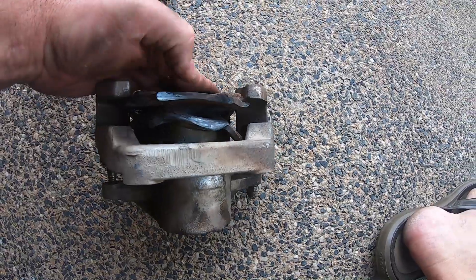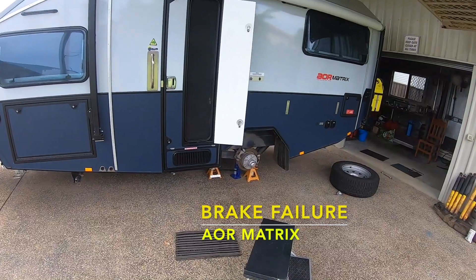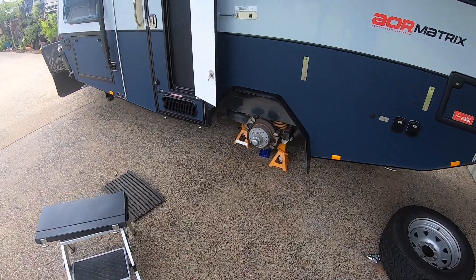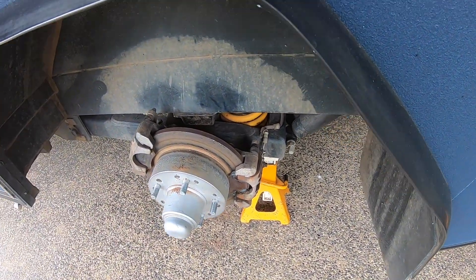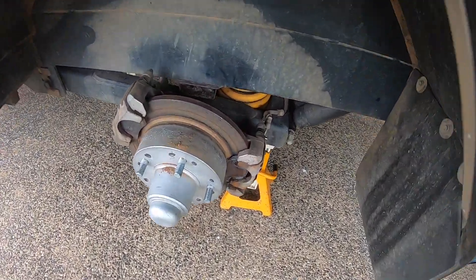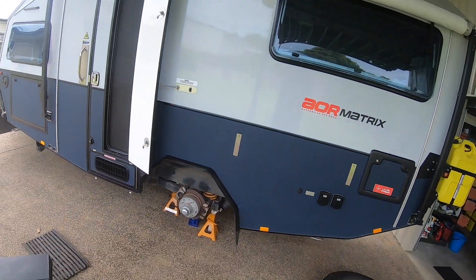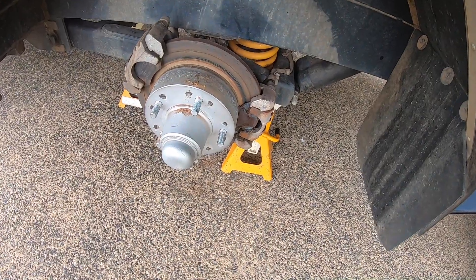See that inside disc pad — it's all melted, just pointless. G'day punters, another Matrix video by necessity rather than design. I was just under there doing some pre-touring checks and noticed a dome nut missing from one of the back calipers. More distressing was the calipers were really close to the rotor, and there's probably no pad left on that. 17,000 k's is about how much this has done. I'm guessing my trailer brakes were set up too high.